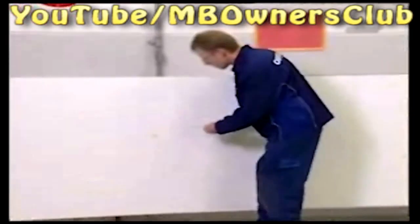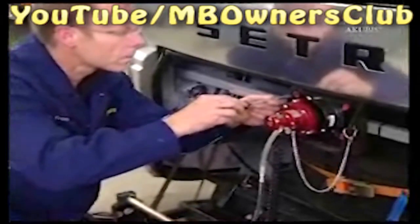Now measure the distance again from the drive axle to the board — here it's 19 meters 50. Measure the other side too and set the board parallel to the drive axle again. The laser beam of the adjustment device is not on the previous mark; however, this is the target point of the laser beam. Therefore, adjust the distance sensor until the target point and the mark are identical.